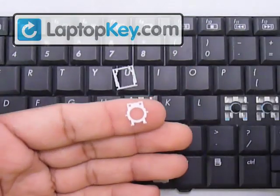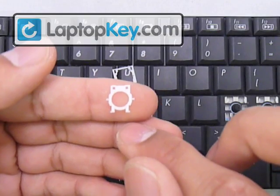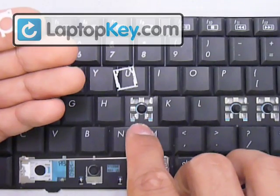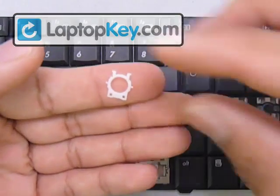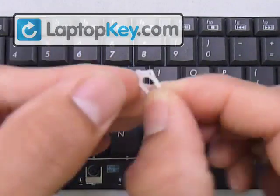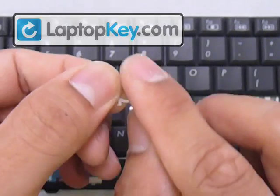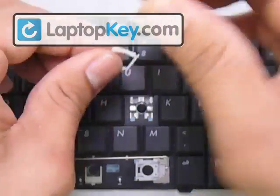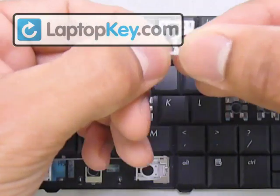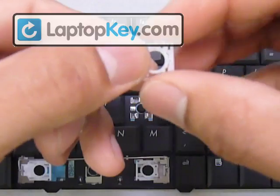Get the next piece, which has two pins in the middle — those are going to click onto the other hinge in the middle, and the bottom part is going to go underneath the hooks that are closer together. Make sure not to put this piece upside down using the same technique: feel the sides — if you feel a bump, that faces and touches the keyboard; on top it's one smooth piece. All we have to do is click one of those pins onto the hole in the middle — do the left side first, then click the right side. Now both pieces are one.